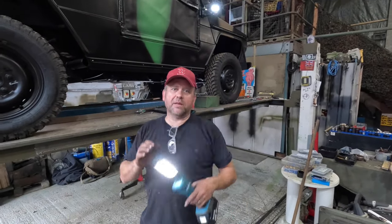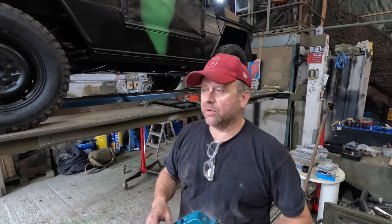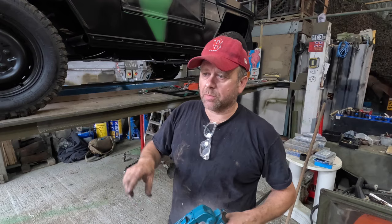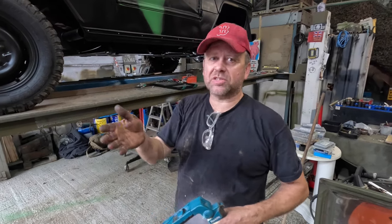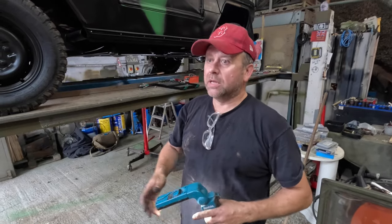We had thought we'd finished with the P4 after these months and months of work on it. Yet during our thorough test driving, we found that the starter motor wasn't engaging fully each time. So we changed the starter motor, that didn't change it. So we went in, turned the engine over, looking in where the starter motor actually is, and we could see that three or four of the teeth are actually sort of ground away. It must have been a really bad starter that was on there before. Someone had been repeatedly trying to start it and it's just chewed those teeth up. That means that about every 1 in 10 starts you'd have a problem again.